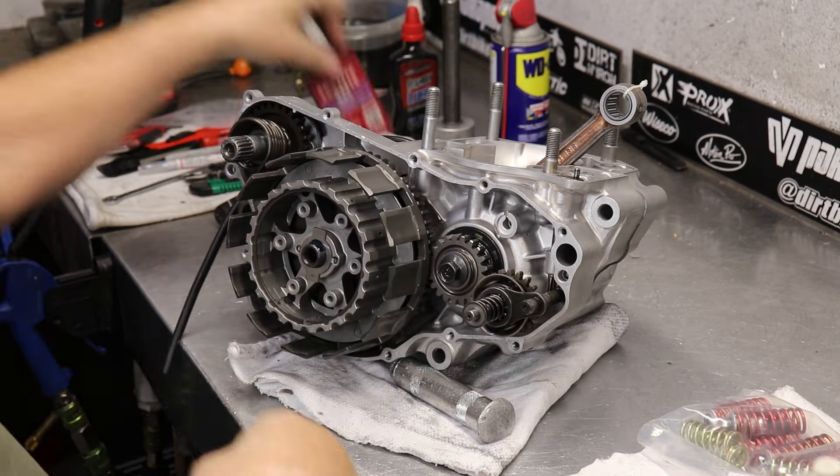You can get a good look at how nice our cylinders came out. Tom Morgan is the one who ported these and got everything spec'd out. Those numbers in the piston are from when he gets it replated — replated for Millennium. He's got the power valve already all assembled. Brad likes to get a little bit of gasket seal — like Yamabond at the base right there — so that it doesn't ever blow out the front or back of the base gasket.